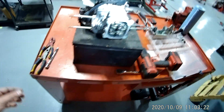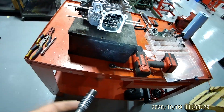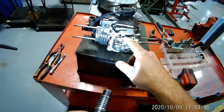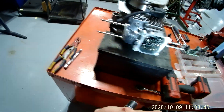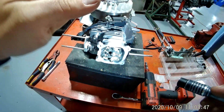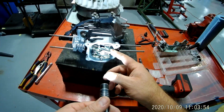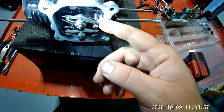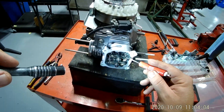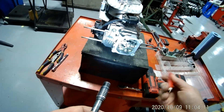If you're looking here, we're going to see a few piece parts, and you will find these in pretty much all your engines. The first one is this right here — this is called a rocker arm. What it does is it acts as a fulcrum point to push the valve open or shut whenever the camshaft tells it to. This right here is called a push rod. That's connected to the camshaft — it pushes the rocker arm up, which in turn pushes the valve down. And that's how you get your valves to open.